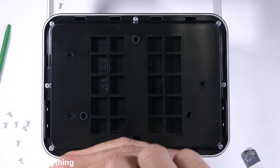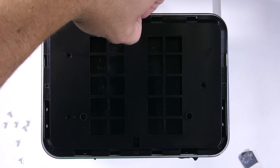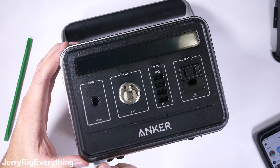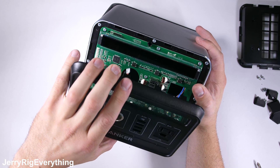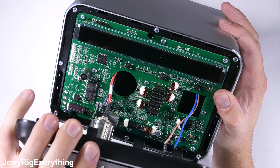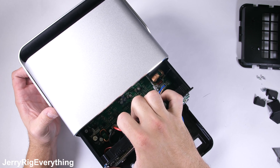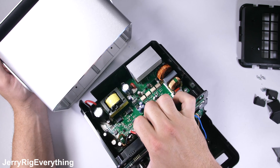These interior screws are different than the exterior screws, so I'll keep them in a separate pile. The front panel has the same style of clasp that the back panel has. I'll unclip those and then pull off the faceplate, exposing some long wires headed to the outlet and an additional 8 screws. Once those are out, all of the circuits can pull away from the aluminum housing. And here's the cool stuff.